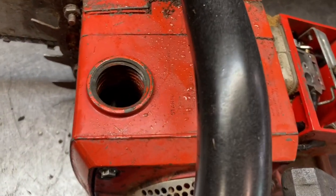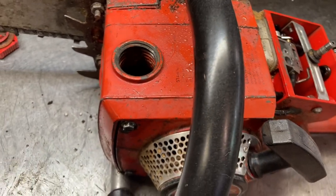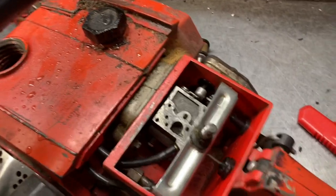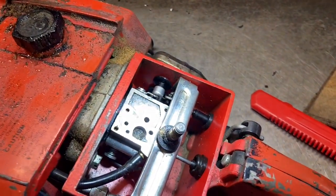So what I did was just really boil out that tank using a hot pressure washer, and of course I figured the carb may be plugged — and you can look at that screen there, it just plugged up tight.